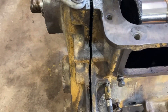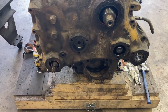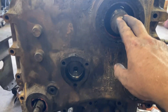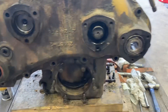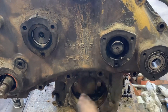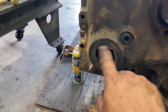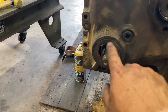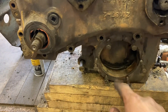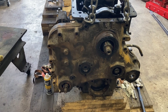Right now what we're doing is cracking and then taking the front cover off. We've taken the crankshaft pulley off, camshaft retainer, the auxiliary gear retainer, the blower drive, and that's the oil pump up here — and that's the fuel pump drive. The water pump goes in there. So we're just gonna pull this off now and you'll be able to see the gears.